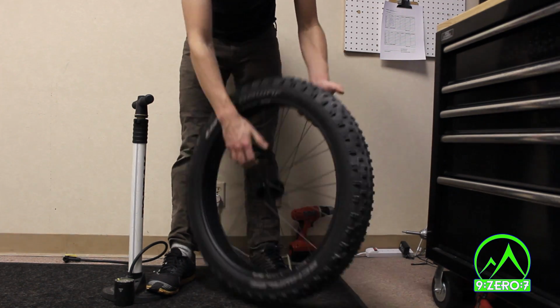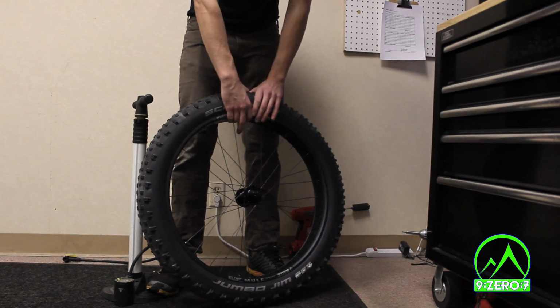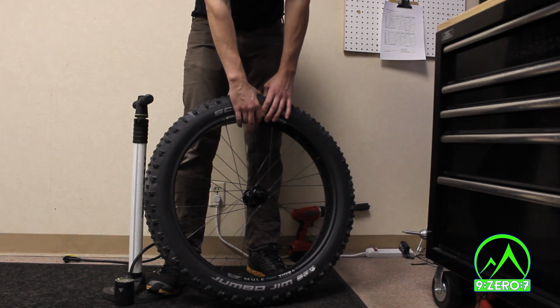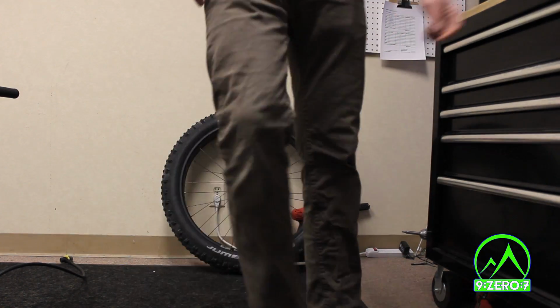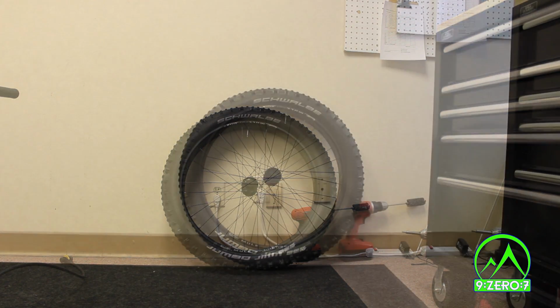This is normal. Typically, this will be about 15 to 20 psi. Do not overinflate the tire. Now it's time to let the tape bond using air pressure. Leave the tire inflated between 12 to 15 psi from anywhere between 1 to 24 hours. Past 24 hours is likely not necessary, with an ideal time being several hours.